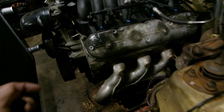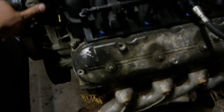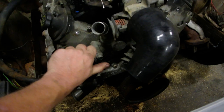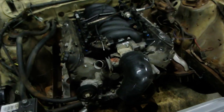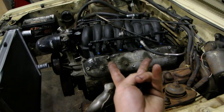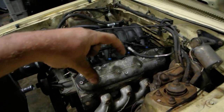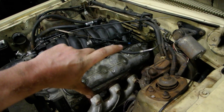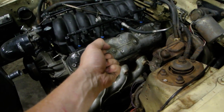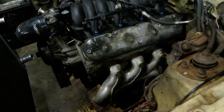And there's nothing holding this engine, just the mounts. Pretty incredible. There's no trans and nothing, no jack underneath holding the oil pan, and that thing doesn't move, you can shake the whole car. It's incredible. It's just 2 bolts. There's 4 bolts, like 2 top and 2 bottom. And we just put one across diagonally, a piece of plate steel, and then put a piece of box tubing in the center, and then weld it to the K-member.